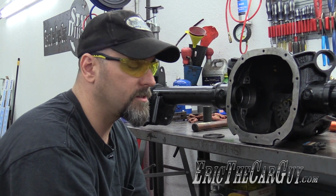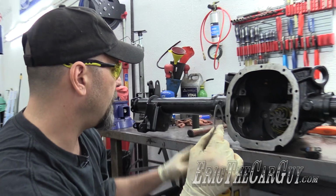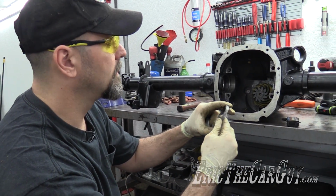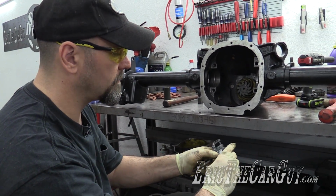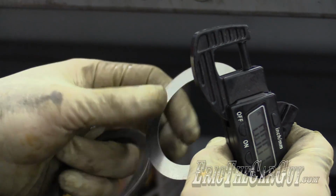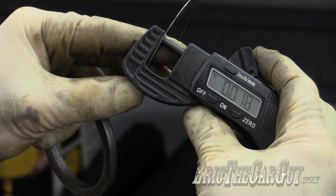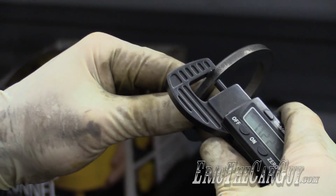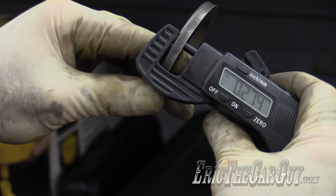Having made many adjustments to this up to this point, I know each one of these thinnest shims is about 1/2 millimeter. And I think that 1/2 millimeter would be great over on this side. So I'm going to add 1/2 millimeter to this side over here. So I'll have that, and actually that originally started out as, why don't we just check our measurement, 254, 253, with this shim, which is also about 19 thousandths, somewhere around that neighborhood. Adding that to this side makes it 274 total over here.